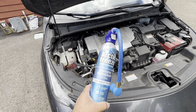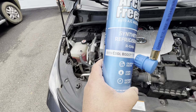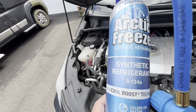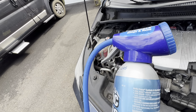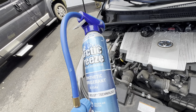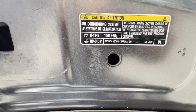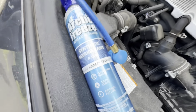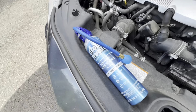I'm going to show you how I recharge my air conditioning. This stuff is actually pretty easy to do. This is the refrigerant R134a — it's got a little gauge on it which is helpful. I've used these for years on BMWs, Toyotas. This is for the Prius Prime, and if you look here it tells you what kind of air conditioning refrigerant you need. Make sure the can says R134a — if it doesn't, you're using the wrong thing.